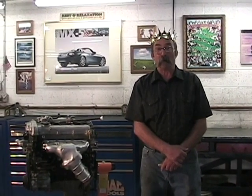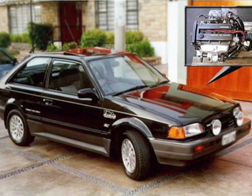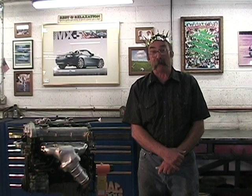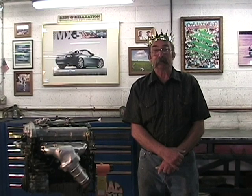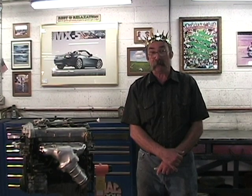As a lot of you already know, the Mazda Miata initially used the engine designed for the 323, which was a front-wheel-drive car. In that car, the coolant entered through the front of the engine and exited through the back, carrying all the heat with it. In the Mazda Miata, the coolant enters and exits the front of the engine, so the rear of the engine develops a hot spot.